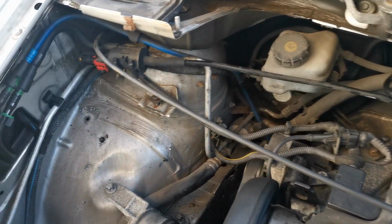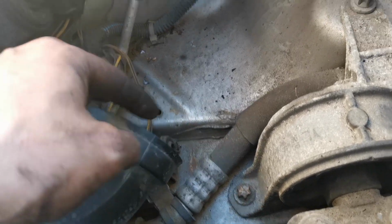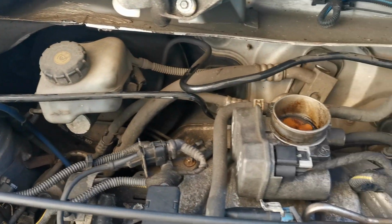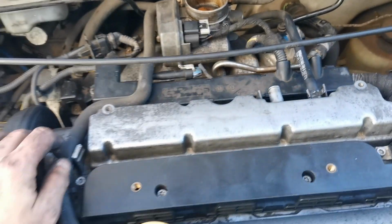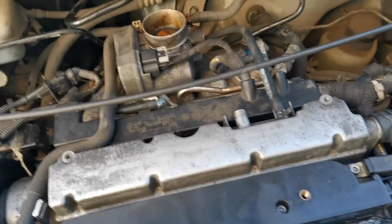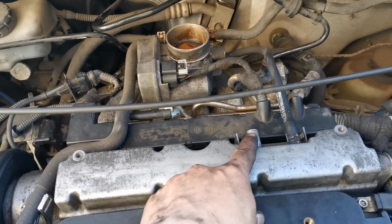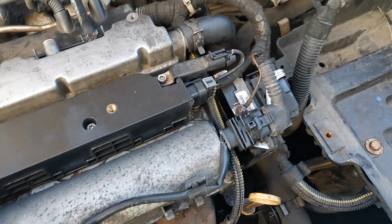The air box literally just goes into a little cup down the bottom there and into this, and goes onto this T30 Torx there. That then clips onto the top part of the airbox, and it pretty much bolts on with a Jubilee clamp onto there. As we say, guys, we've got the cover which has these two Torx bolts that go in there, but they're actually Allen key bolts. The airbox also has a pipe that goes onto here as well, so I haven't got anything missing, if you were wondering. That is the airbox assembly, and so I'm going to do some more, and I'll bring you back again in a little while.